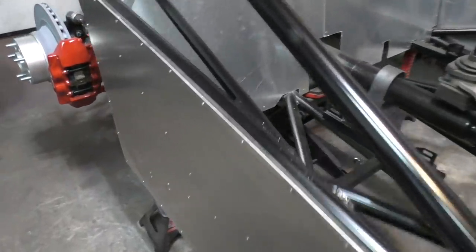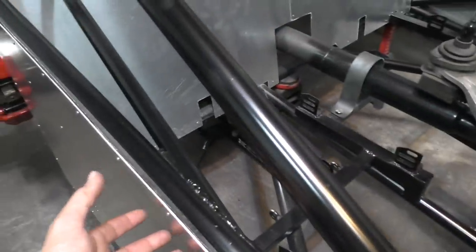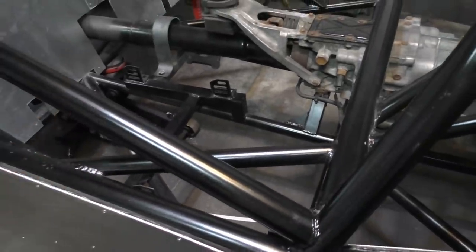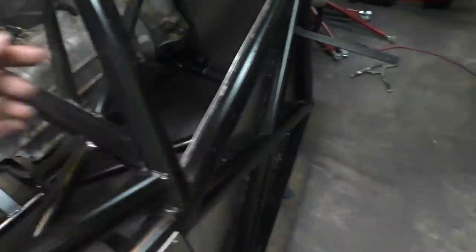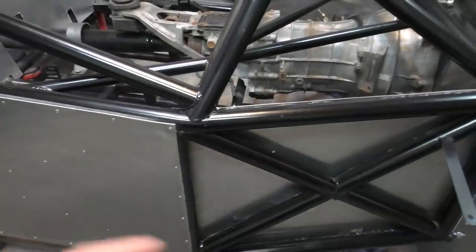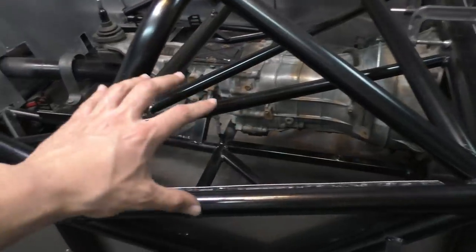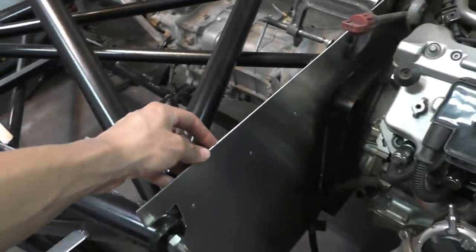The purpose of these aluminum panels is mainly for side impact protection — so if a car bashes into this car from the side with a sharp splitter, it won't come through the steel tubes and injure the driver or passenger. The front footwell panels are mounted on the inside so your feet can't go outside the chassis in a crash, and to protect them from the steel tubes. All this will be covered later by body panels — there's going to be a whole carbon fiber section going over this riveted area.